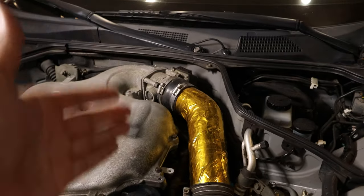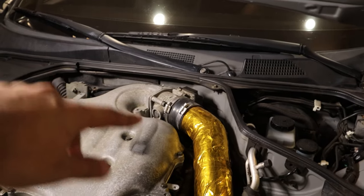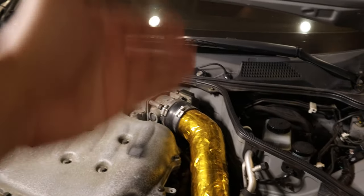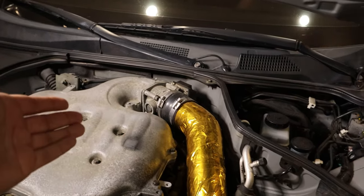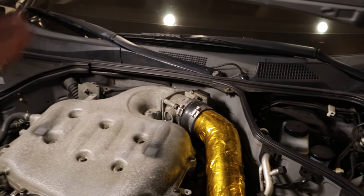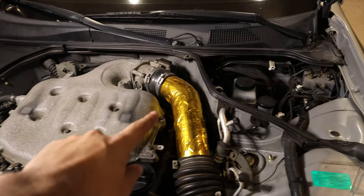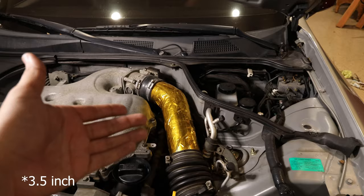In today's video, we're going to be installing a 75 millimeter kit that I picked up. The best part about this kit is that it's almost a hundred dollars less than the cheapest kit available online. What the kit does is essentially replace your OEM 70 millimeter throttle body with a 75 millimeter throttle body from a newer Nissan Maxima. The kit includes an adapter so you can bolt the bigger throttle body onto your existing manifold, and it also comes with a harness because it uses a different connector type. You don't need a tune, but it is recommended.